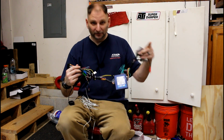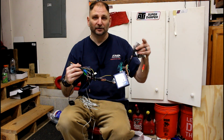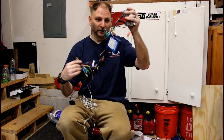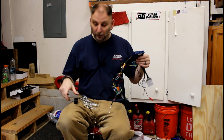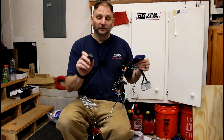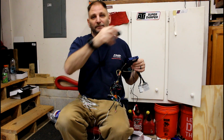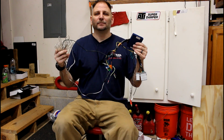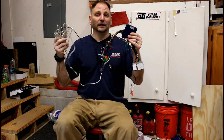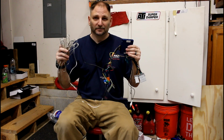One thing I'll say is I'll show you on my little camera, there's a little spot to the passenger side of the stereo, to the right side of the stereo, where this module will fit in pretty well. I'm going to sound deaden that, and you lose the chime. This is the new chime on the left side. I'm going to double sticky tape this on the other side, and I'll show you that. And this is the turn on wire for the amplifier. Just take your time. You can figure it out. No problem. If you've gotten this far, you can do this. And again, patience.